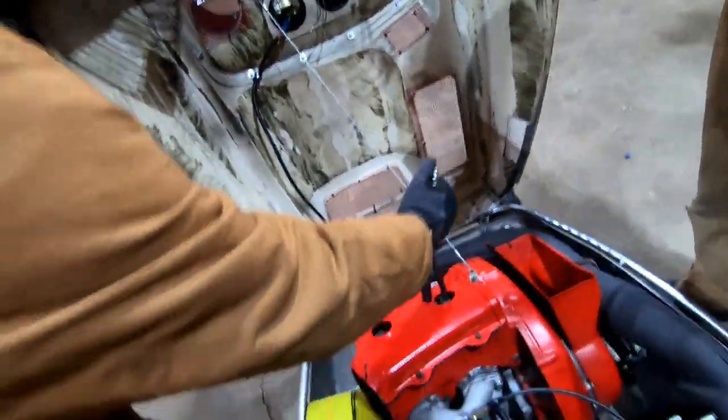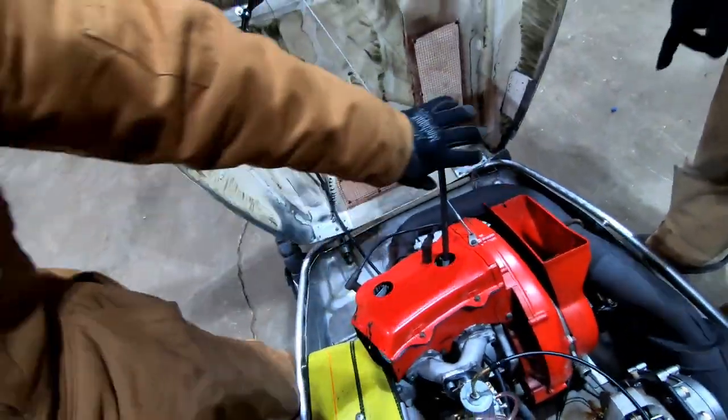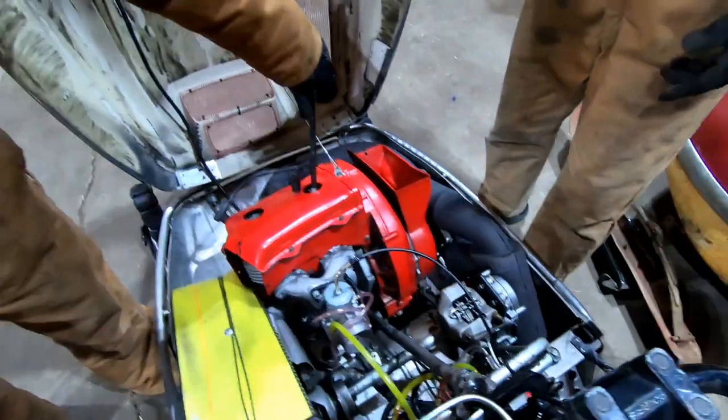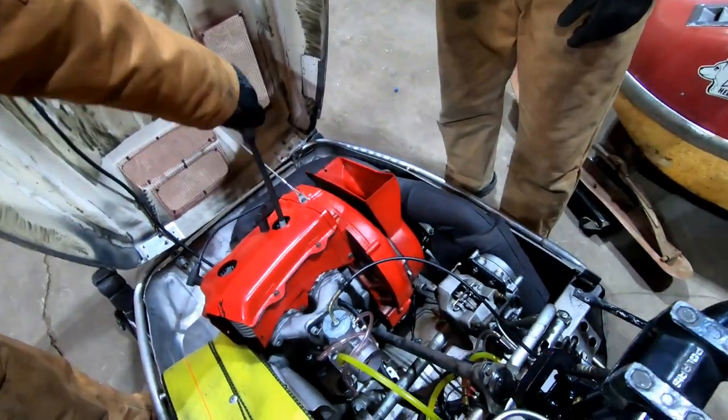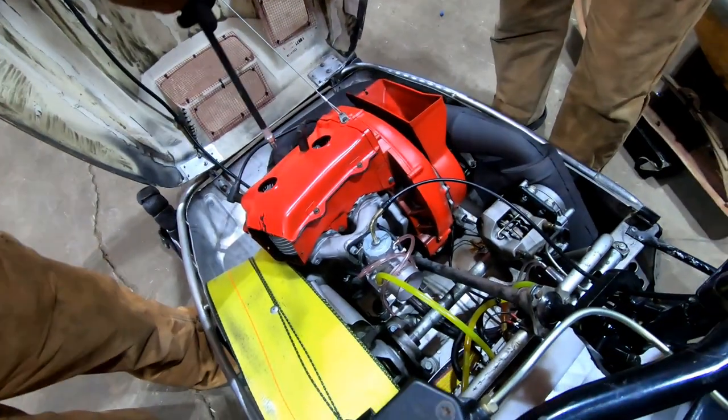And this gauge, I don't know, we don't know how good it is. It usually is all right, but. Remember, we read my Jag. This is a Lyle. My Jag got 130. Is that the Harbor Freight? Is the valve tight in the end of it? Yeah, valve core, you need to tighten them. You take them out when you do leak downs.